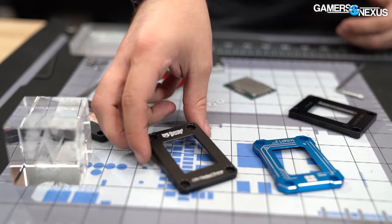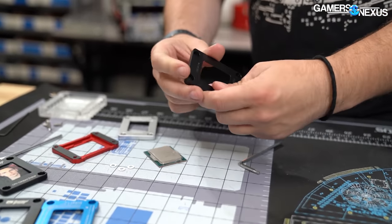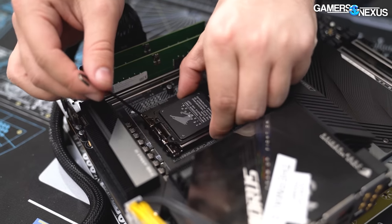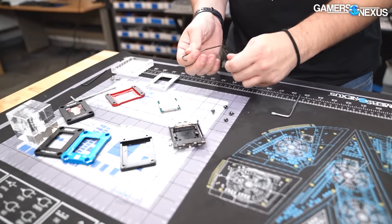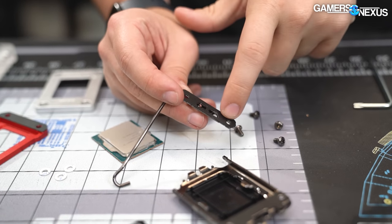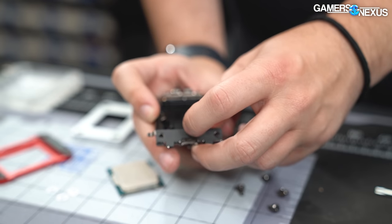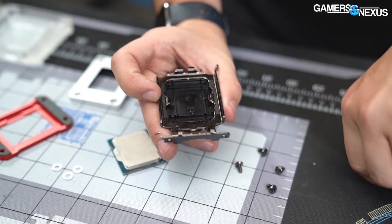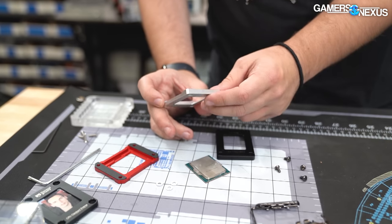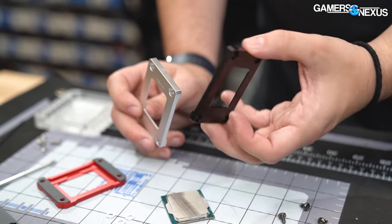There could theoretically be an advantage to Thermal Grizzly with memory overclocking at very high frequencies, but we're not particularly qualified to test that, so we don't test that aspect right now. Looking at the stock Intel ILM backside, it has its own pads — one for contact with the board, partly to avoid scratching and partly to create an electrical barrier in case anything might short. The Walmart frame doesn't have any sharp edges or burrs, but it does feel like cheaper quality. It's still aluminum with standard anodization. Thermal Grizzly uses a more expensive 7075 aluminum and their manufacturing is a little more expensive, but the product is so much steeper in price that we understand why a lot of people might go with a $4.50 option from AliExpress or $8–$14 from Walmart.